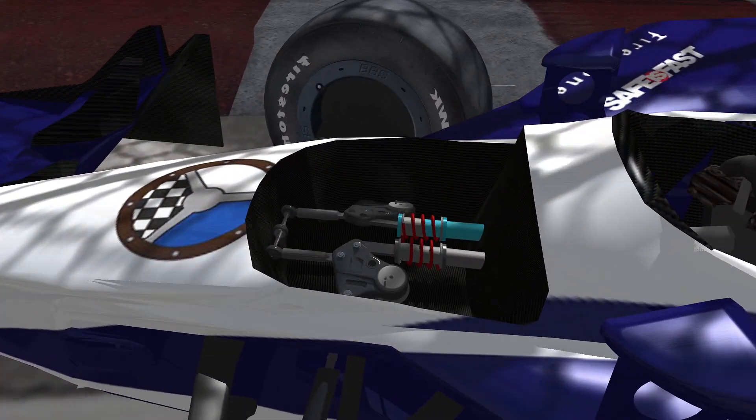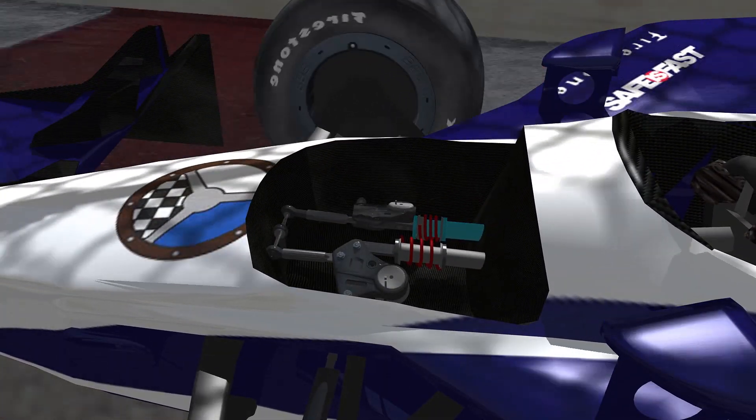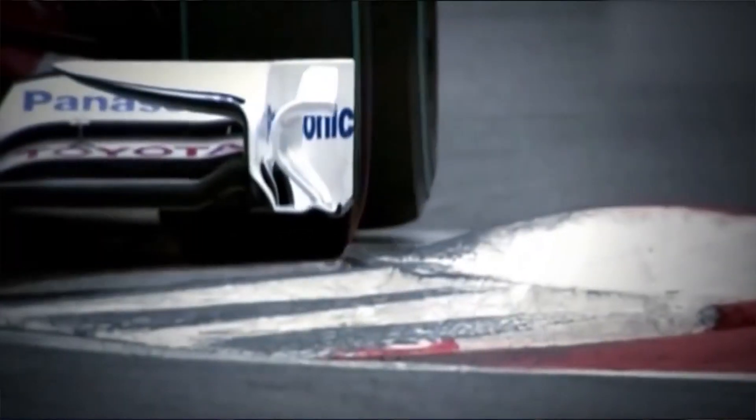On a race car we're looking for two different things with a damper. First, we're looking for the ride over the bumps and dissipating the energy of the springs over the bumps. Bump you can think of as the wheels coming up — the car's hitting a bump, so that pushes the wheels up.